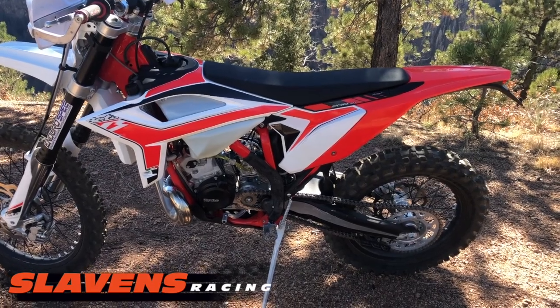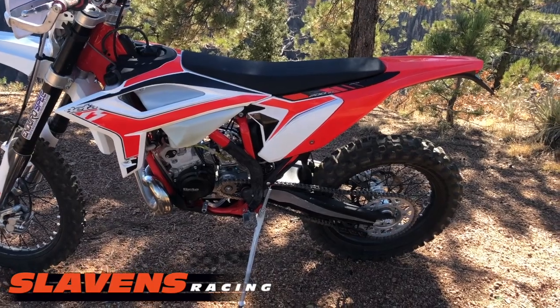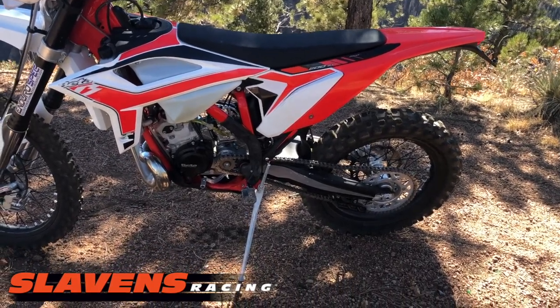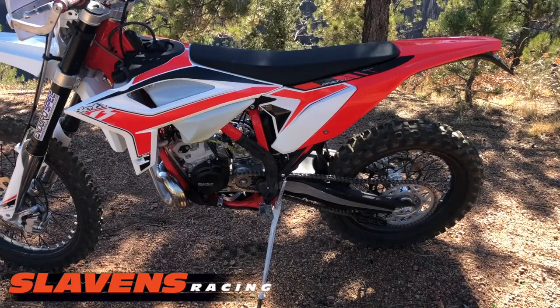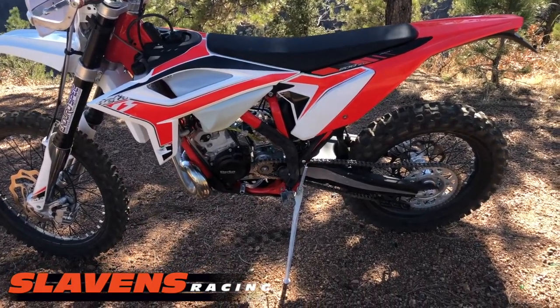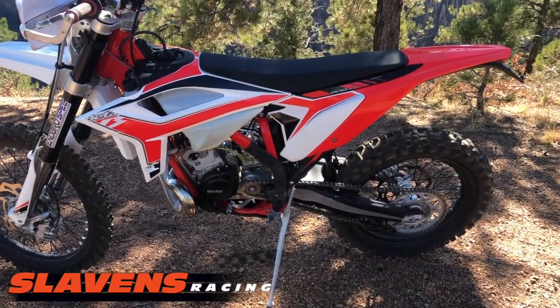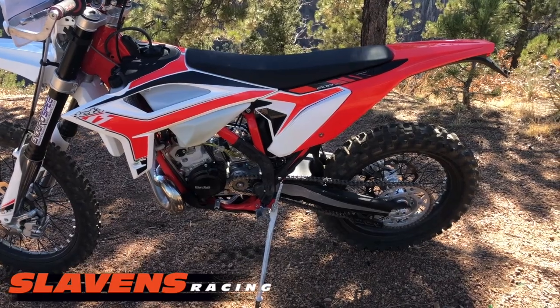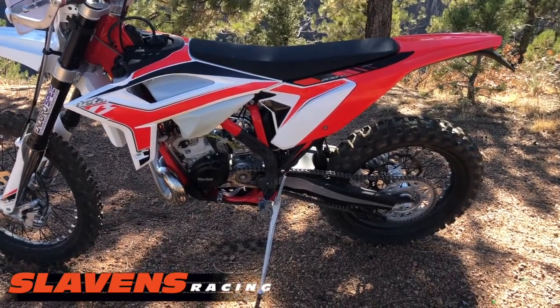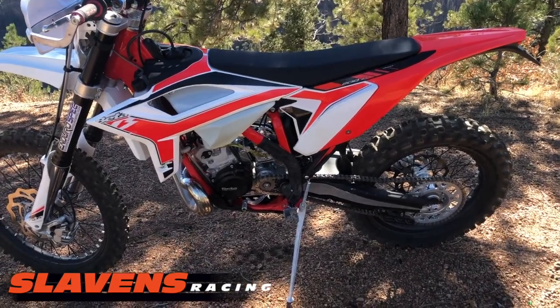I mean, the carburetor's definitely helped the bottom end performance. Bottom end, the lower part of the mid-range. Probably helped the rest of it, but that's a little bit harder to evaluate on a trail. I haven't got that much time on it yet, but I definitely like this carb. I pulled the choke, the new left-hand choke, and bam, just hit the button and it instantly started. It started also extremely quickly every time now that the engine's warmed up.